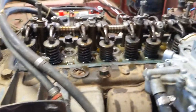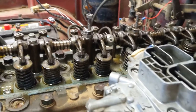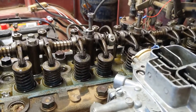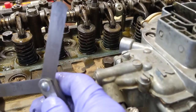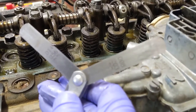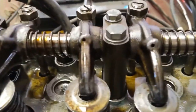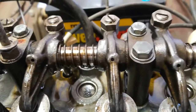What I've got to do is bump the engine around a little bit and then measure the clearance, and do this for all 12 valves. The intake valves are — you can read that, it's probably hard to read — 8 thousandths. And the exhaust valve is 14 thousandths. It's easy to get them mixed up because they're alternating. You can see the intake runner here and an exhaust runner right there, so the valves are in pairs. To keep myself from getting mixed up, I've marked the tops of the rocker arms with a little piece of white chalk so I can be sure I get the right gap everywhere.